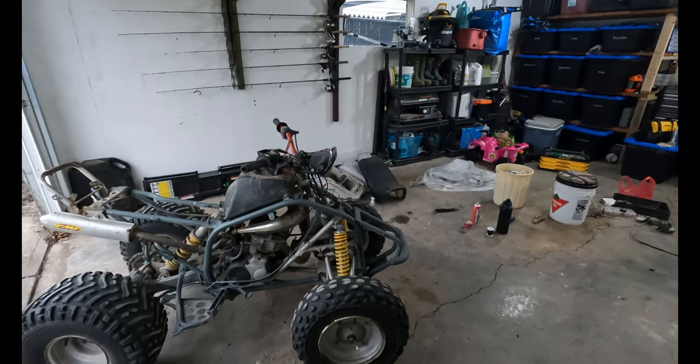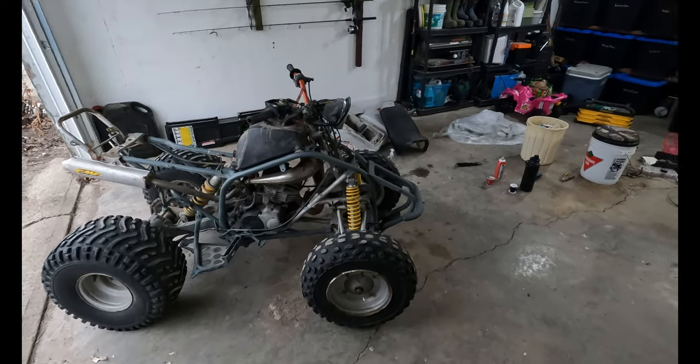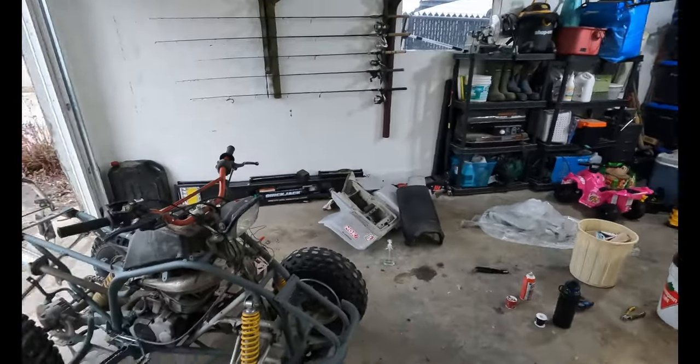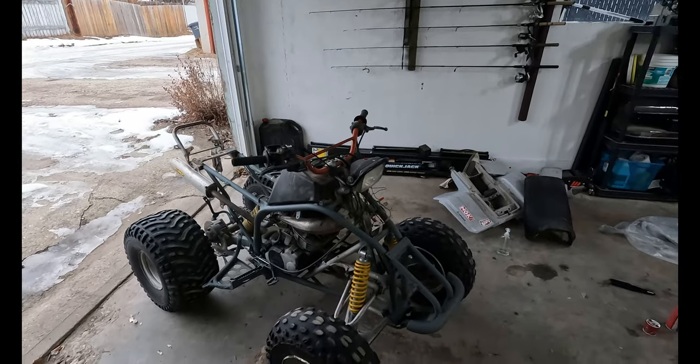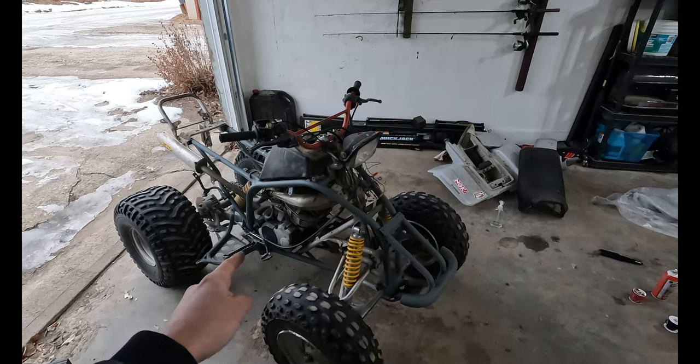So that tells me we could probably do with a little bigger jet. Main jet, that is. This pack luckily came with a few. I'm gonna put one size bigger in, and that will give me a full range of adjustability with the air screw.